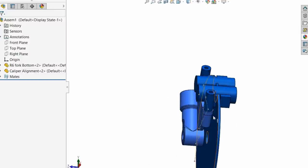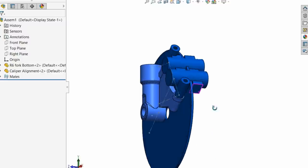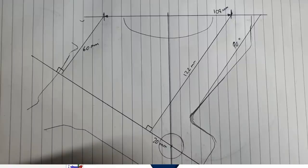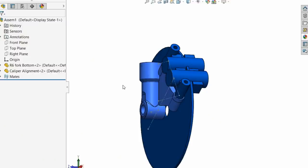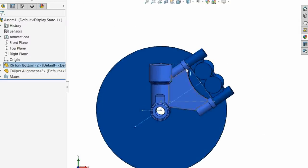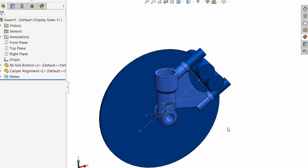And you've got to remember, a lot of this is just to demonstrate it. Normally, I just draw this down with chicken sketching. I actually did do a drawing, and I'll show you that as well. It's basically just a trace around it to get the angles and some of these lengths right: this length here, this length here, and the angles that are here. Just to get all of those spot on, you can trace around the thing and draw key surfaces or key locations like holes, and where this plane is versus this plane, and so forth. Anyway, I hope that makes sense, and I'll see you in a bit.